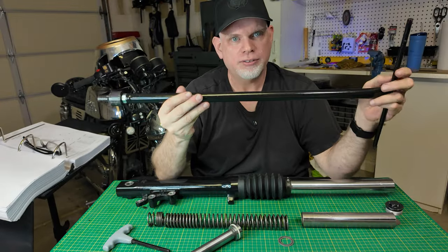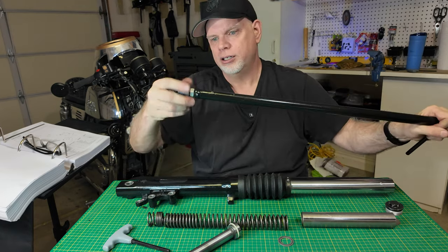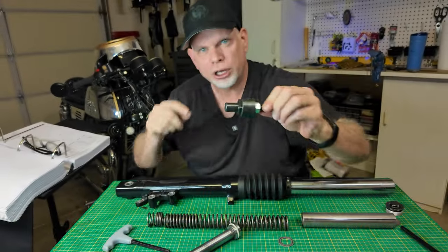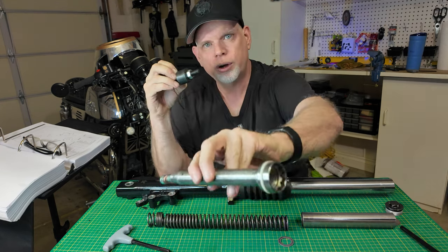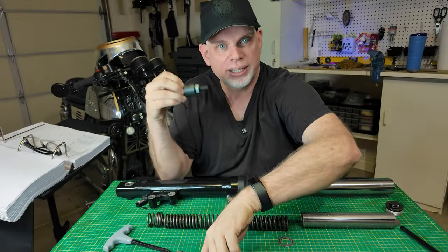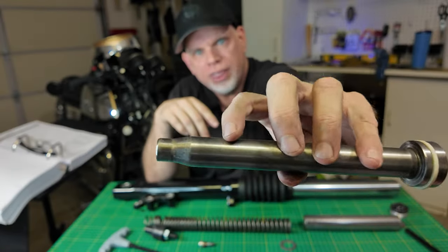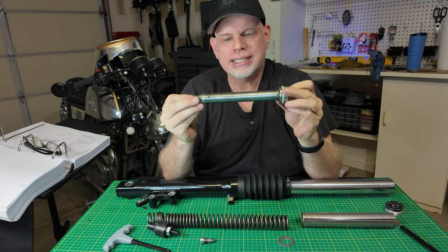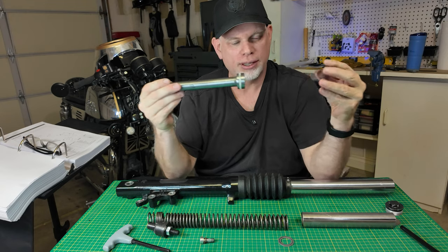So it's not too difficult to make one of your own. You can actually unscrew this piece here, so I figured I'd take this off and do some close-up measurements so you can see exactly what size you would need to make in order to fit into the top of the damper tube and hold it in place while you unscrew it. Now, why would you need to do this? If you look at the stock tube, there are two tiny three-millimeter holes, one on each side, and that is what controls the damping. The fork oil flows through those holes, and that's what controls the compression.